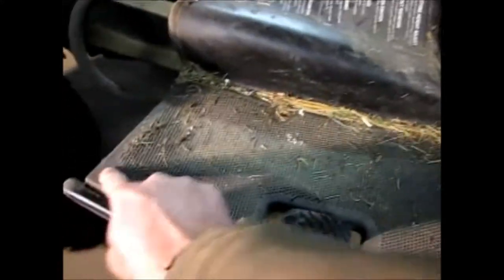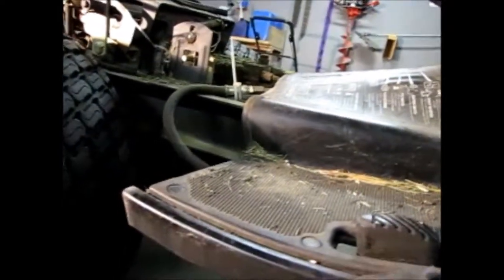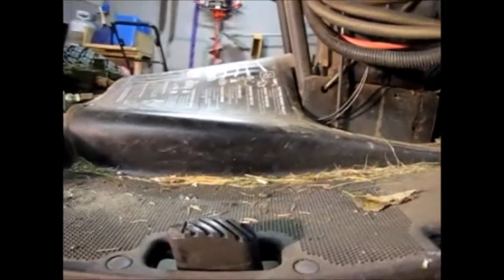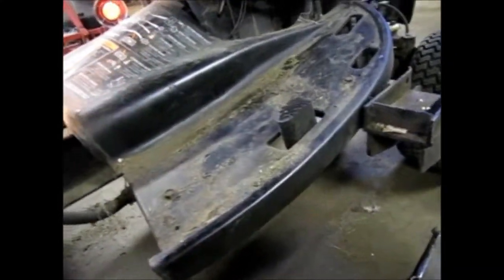The next thing to do is lift these floor mats off. Each place you see one of these little button heads, that's a fastener. You just take a fairly wide screwdriver or a putty knife and just kind of work them up out of there. Unlike most cars that use those, these here are fairly reusable — I've never bought new ones and I've had this floor off probably three other times. That will reveal your bolts that hold this deck on. Once you get your floor boards up, you've got three bolts on each floor board — six bolts total — and then this floor platform just lifts up out of there.